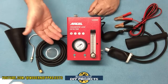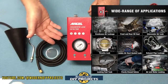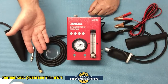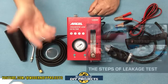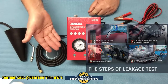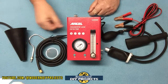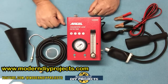This machine is very versatile. You can use it to find leaks in the EVAP system, throttle body, diaphragms and seats, EGR valve, hoses, brake booster, and oil leaks. Have an oil leak and don't know where it's coming from? You can pressurize the oil system with this and find it. It also works for headlight or taillight assemblies — if you've had water intrusion into your lights, you can find exactly where it's coming in. There are many more uses, and once you have this you can get really creative.